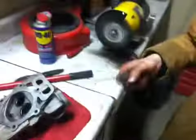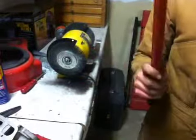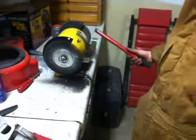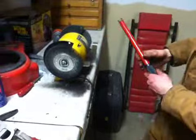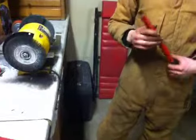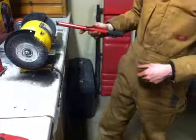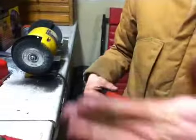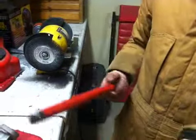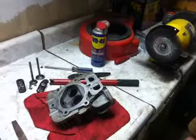I've done screwdriver tricks before and it's hard. I think the easiest way I've had experience with is a valve spring compressor, but this will do the job. It's really easy to make - just grind it out on a bench grinder or use a die grinder. A grinding wheel is the best I think. Make sure it's steel and fairly thick so the sides don't spread apart and break. That's how it's done - please rate, comment, and subscribe.